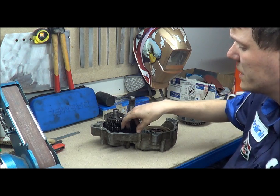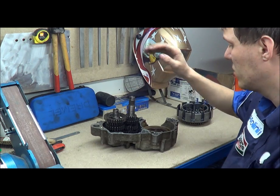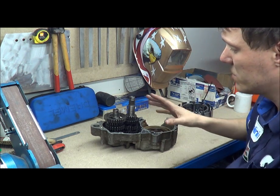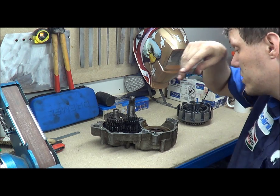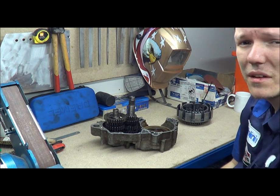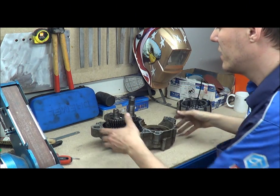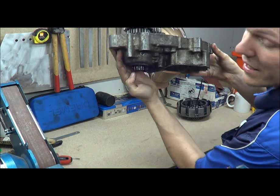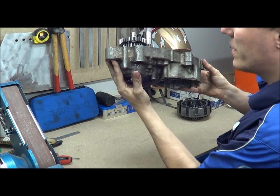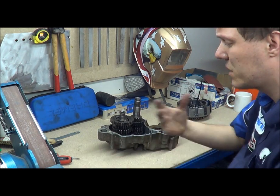Basically we've got a case and a half here with an input and an output shaft. The selector drum is missing, all the other bits and pieces are missing — like the clutch — because I'm not really going to go into that. I just want to show you what a gearbox looks like and what's in there. This is your input shaft, i.e. power going into the gearbox. This shaft is the output shaft, and on the reverse of the output shaft are your splines here, where your sprocket goes, then your chain, and then your rear sprocket.